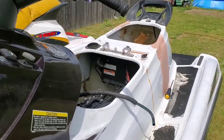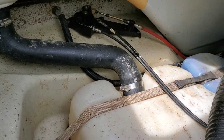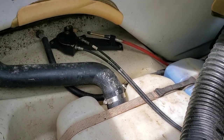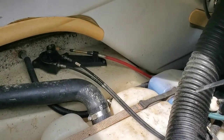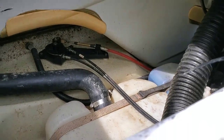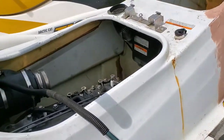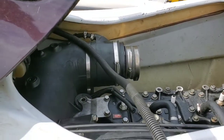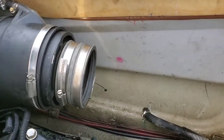So this is the machine. I popped off the filler neck to the fuel tank, took a little fuel sample, and there was definitely some water in the fuel as I expected — which is pretty common with these. Keeping fresh fuel in it as full as possible and stabilizing is the best thing you can do. So I took the old fuel out and put fresh fuel in with stabilizer, and I'm about ready to put in the carbs.